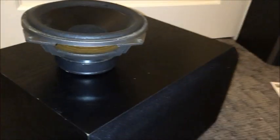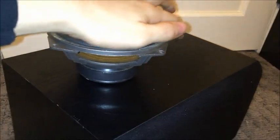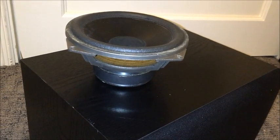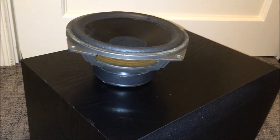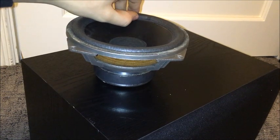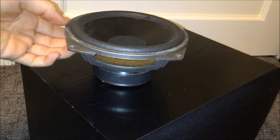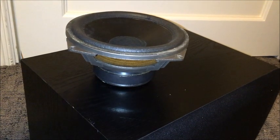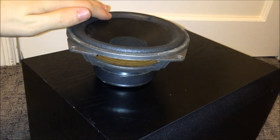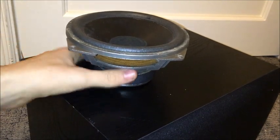Based on that, what we have to do with the kind of blown speaker is measure the inner diameter and the outer diameter of the surround, then buy the part and wait for it to arrive. When the part arrives, we scrape off the original surround, do our best to remove the original glue, and then glue on the new surround. Sometimes the kit provides glue, sometimes it doesn't. The kit for this particular speaker I believe is available on Amazon.